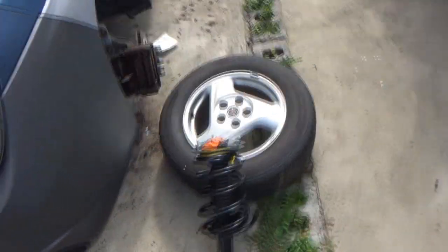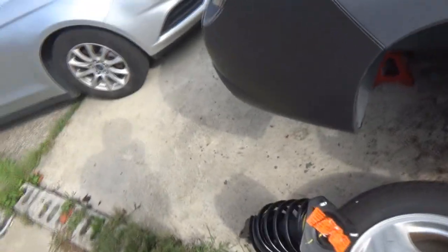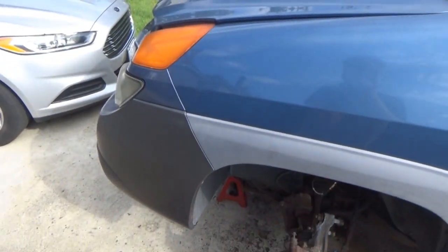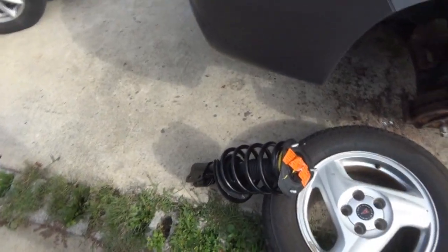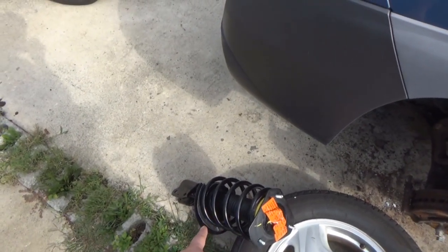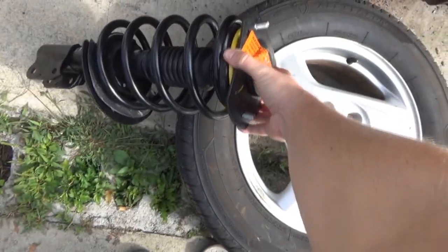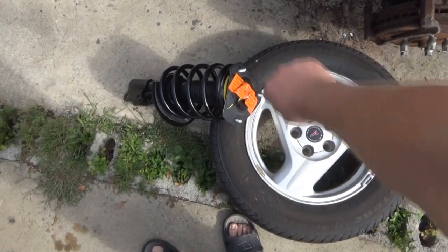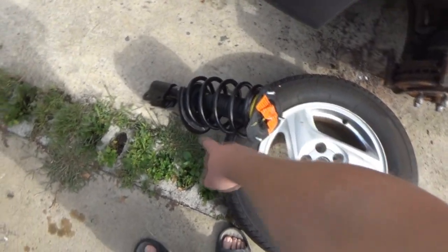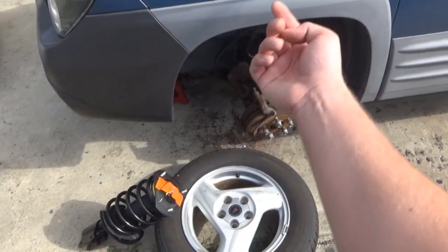So got the struts out and ready to go. I was trying to mess with one of these last night, but I didn't have too much time. I think the bearing plates might not be lined up with the holes. So what I might have to do is try to insert the top half of the strut until the holes line up, and then, once I get them tightened a little bit under the hood, rotate it from the bottom to get the knuckle portion on there, because you can't really rotate this. I don't even know if you could wedge something between those studs and keep your feet locked on the bottom. I'm gonna try to do it this way first and see if we can actually get it to rotate once it's in there.